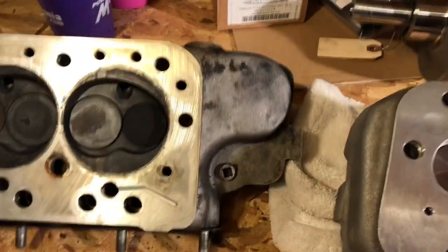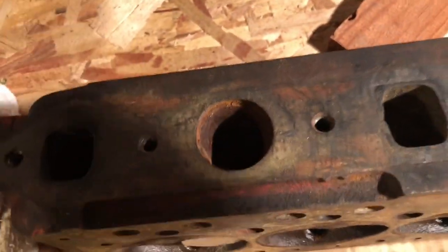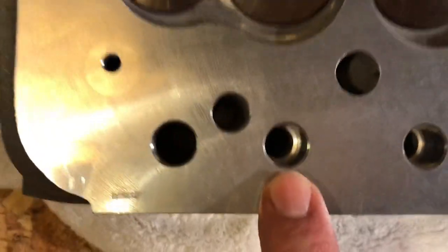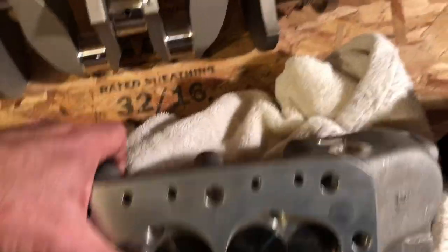One of the improvements — very subtle — is the push rod hole sizes. The Pierce heads don't install a sleeve like cast iron aftermarket heads do; they just have machined holes. Mini Spares realized the difficulty of draining oil out of the top end, so on the intake side they have the smaller hole, but on the exhaust they've allowed a huge push rod hole. That's really going to help get oil out of the top end, since the exhaust push rods don't interfere with a nice port.